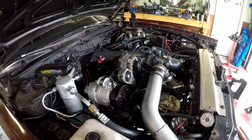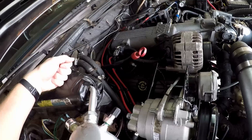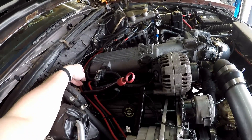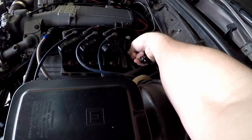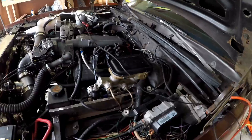You can smell that paint just burning. So this is cylinder six back here, and it has one of the older plug wires on it from another car, and there's a good chance that it's dead. Oh, I didn't tighten the ICM — that is why. This thing is just loose back here.